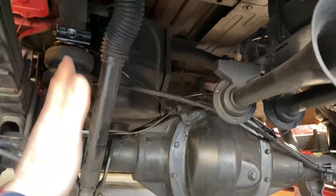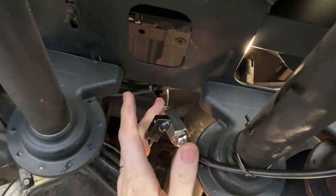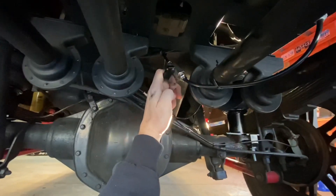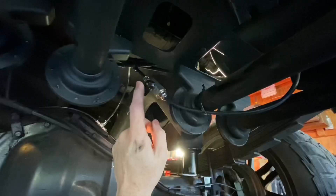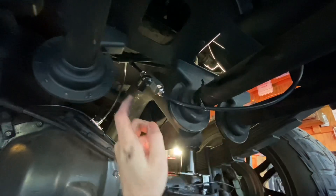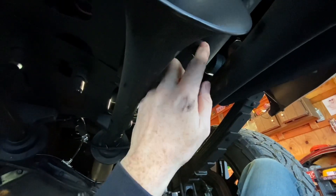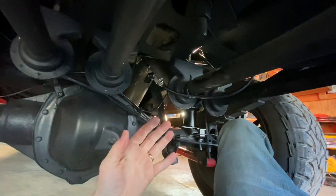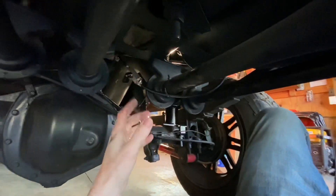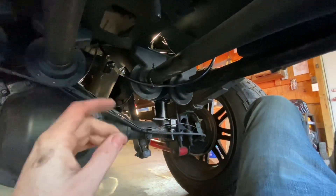Check it out — here's my setup. You can see the airbags are installed, and I plumbed the line across the axle right here where it hooks up to the T. This is where I installed my valve, and then it shoots right up to the tank. Right next to it is the open valve to dump the bags. To inflate, I just turn this right here. To dump, I open the other valve. I always have to keep the shutoff closed, because if I turn the key it'll air the bags up and I won't even know it. What I like about this setup is that it's mechanical — I want to keep this thing stupid simple and easy to fix if we ever have issues.